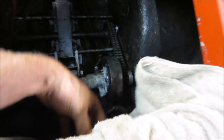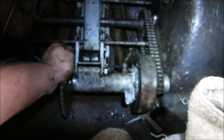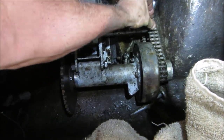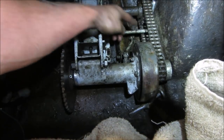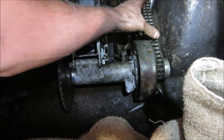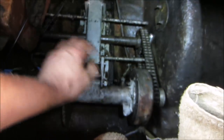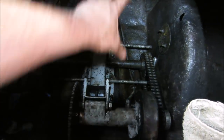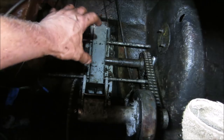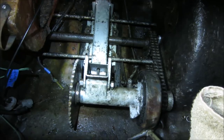So, for instance, on this system right here, this shaft is being torqued up by the engine driving that, or when you're braking, there's gonna be a lot of stress between the sprocket and this sprocket wanting to pull together, either on one side or the other. So they put a con rod right in a direct line with the axle, so it just kind of cancels each other out. It's not trying to pull the axle this way, and it's not trying to pull the shaft that way. Well, you have to keep that in mind at the same token when we build whatever we were going to build here, that we do the same thing, that everything is kind of supported in that direction or beefy where it's mounted to help counteract that. So that's back in there.